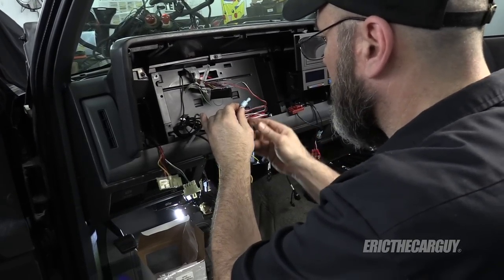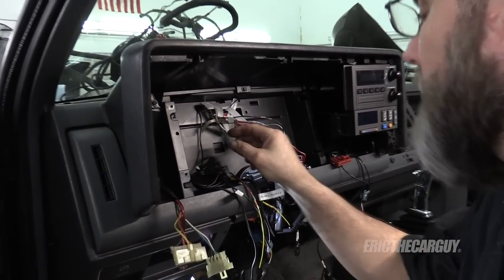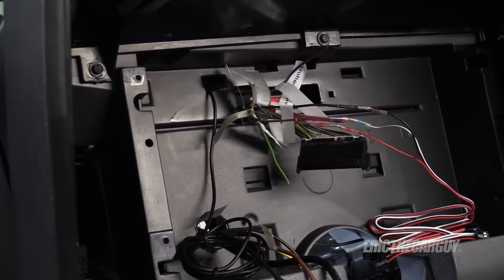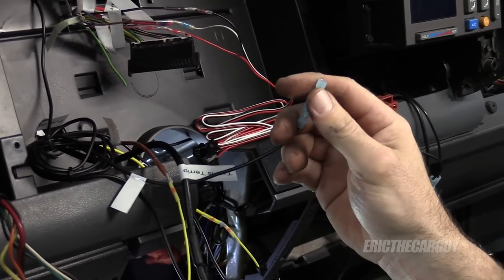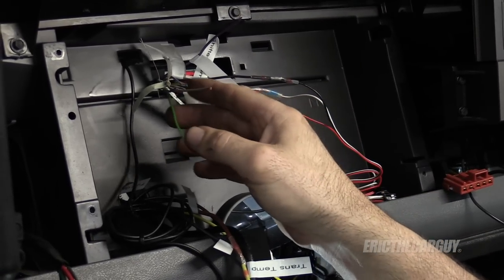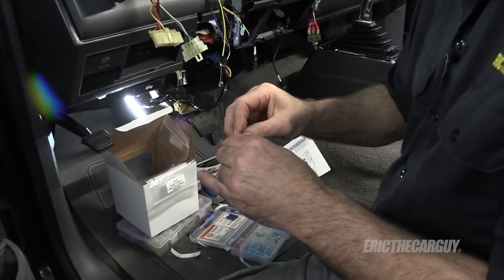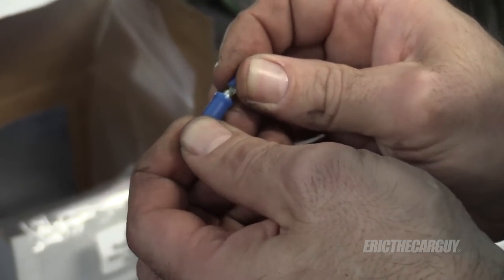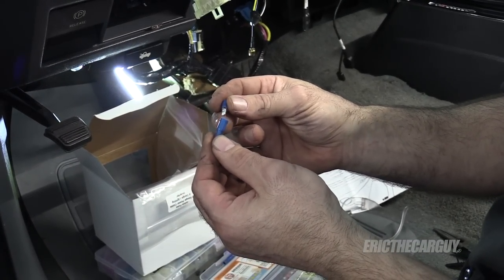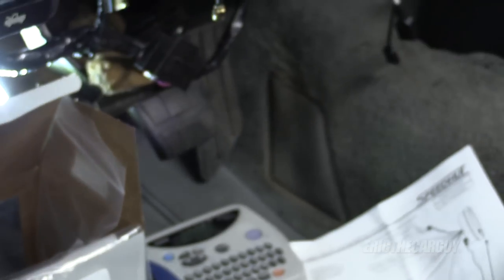I'll use this ground for my turn signal and my brake light, and I'll use this ground for the instrumentation stuff. This one I'll make my own connector and put together the three wires for those grounds on those lights, and put a connector on my ground. This ground for the instrument cluster will stay as the instrument cluster ground. Just to make it easy to find its companion connector, I'm going to put connectors on each one of these wires going to the lights — so I've got one connector for all the grounds.